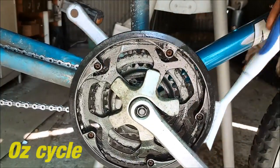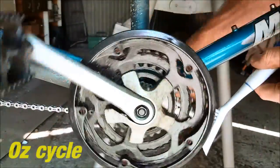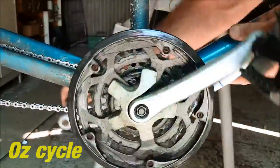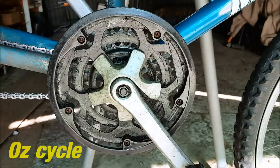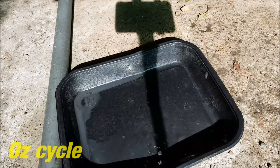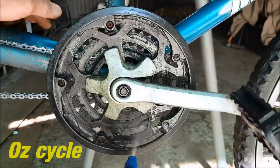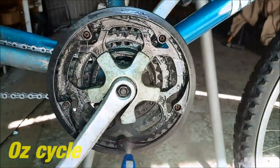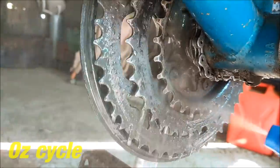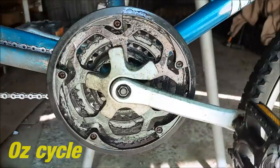This is a must for cleaning your bike: a thin, hard, nylon-bristled brush. Push it onto the chain ring teeth and turn the cranks — do about five revolutions of your cranks for each chain ring and that should do it. Then use a spray bottle of water to wash all the gunk off into the drip tray. Try to spray away from your bottom bracket bearings — keep it below the bottom bracket axle level so it drips downwards. Do the same on the other side, on the inside of your cranks. If it's not clean enough, you can repeat the process again.